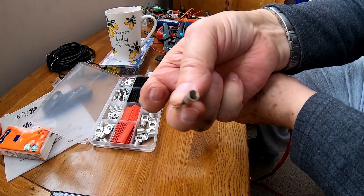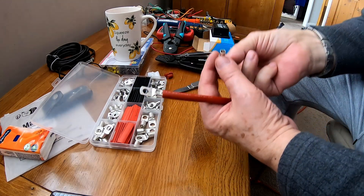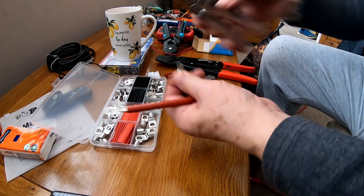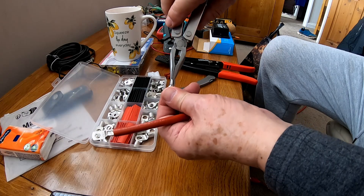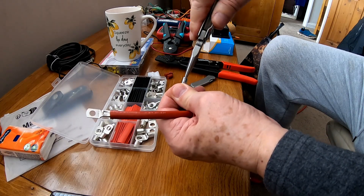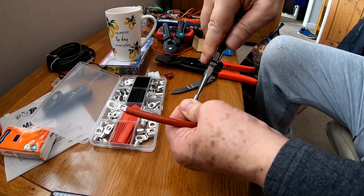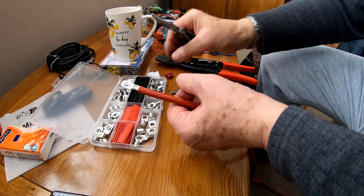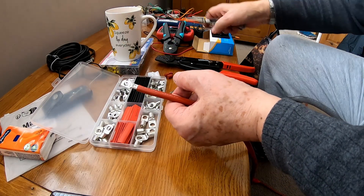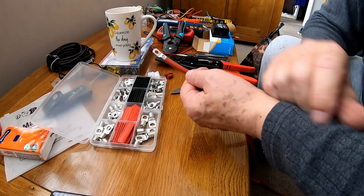What I did notice on these terminals is that — I don't know if you can see that — it's got a slight flap from manufacturing. So what I did is I took an ordinary pair of pliers, snipe-nose or pointed type, put them in, gave it some pressure turning round, and it flared it out, then it went together quite easily. So it's worth looking at them.